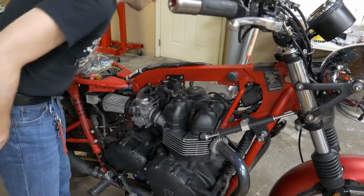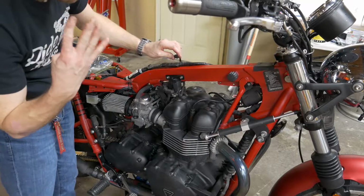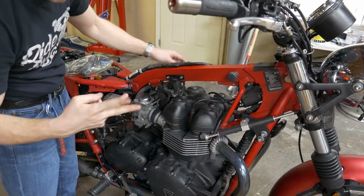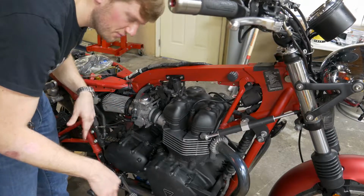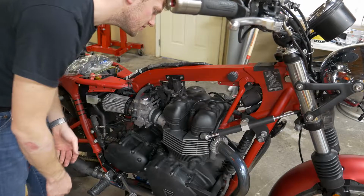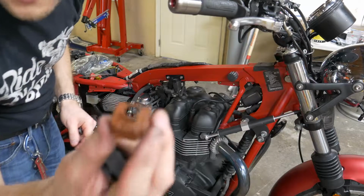And on the opposite side is the fuel tank fuel level sensor plug. So it's got 4 pins. 2 for fuel tank power and 2 for the sensors, probably a capacitive frequency something based, hooks up to the engine computer. Here's that nasty little plastic doohickey.